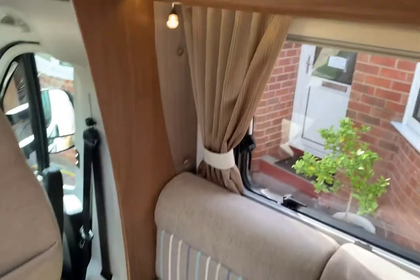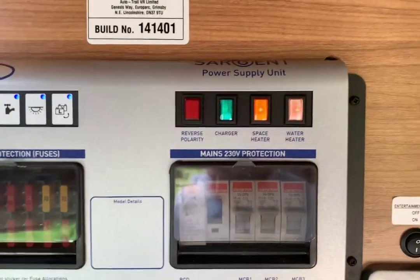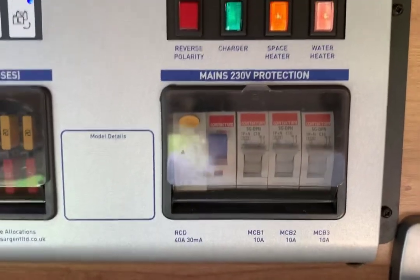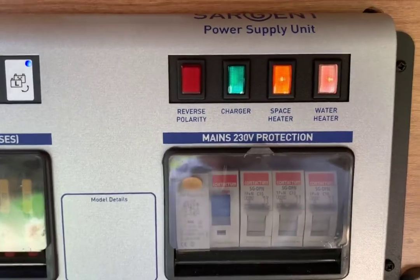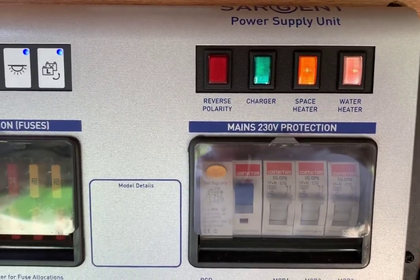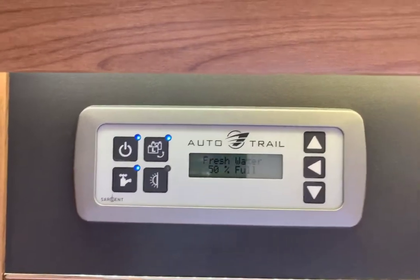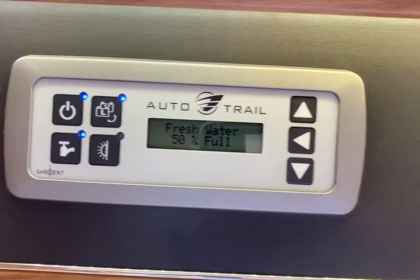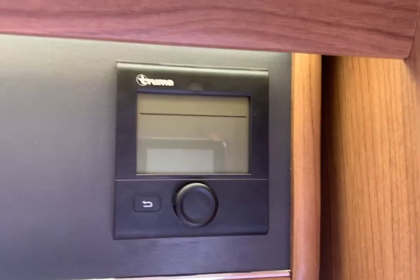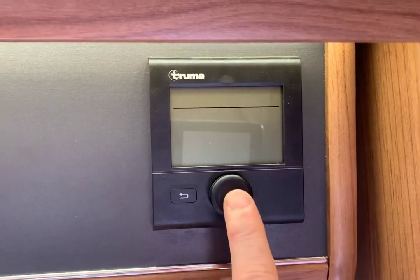Go back to the control panel and turn the water heater button on. Now those two buttons don't turn the water or the heating in the motorhome on — they just enable you to use the other control near the door. Back at the control panel: we've got the power on, we've got the pump on, we know we've got fresh water in the tank and we know there's water in the boiler. So now we're in position to move to the Truma combi control and turn on the heating and hot water from this control panel.